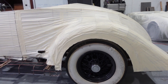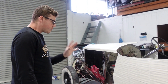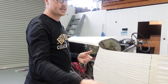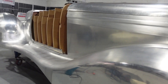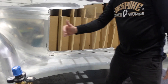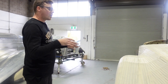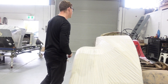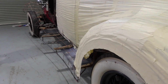I think it's going to be quite a unique design for a Rolls-Royce, but also quite beautiful. The running board was one of the things the owner really wanted — the swoopy reverse curve. You can see here on the Auburn behind, the running board's got that big sweep in it. I wanted to bring that into this car. I didn't want it as extreme because with the Rolls-Royce the construction is so different — the Auburn's guards are sitting quite out wide whereas these were made to be closer to the body. So I don't have such an accelerated sweep here, but it's definitely there and it's visually very nice.